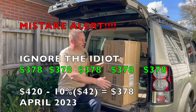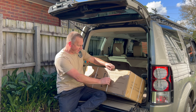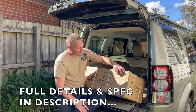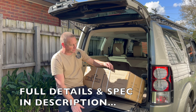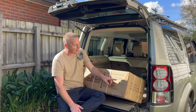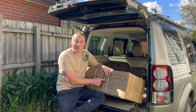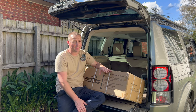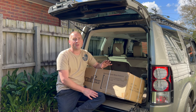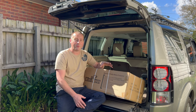So looking at the box specs: it's a motorized trailer mover with a move capacity of 2,722 kilos — that's 6,000 pounds in American. Max load on the jockey wheel is 500 kilograms, or 1,100 pounds. It's a DC 12-volt 550-watt motor doing seven meters a minute — not the fastest, but it's about helping you move the caravan with one or two people rather than a big crew.